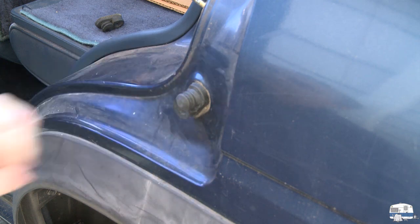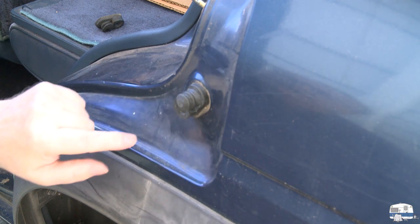I'm going to check the other side and see if that switch is dried out and breaking up as well. It's a simple but critical fix — the battery would run down if the switch didn't open and turn the lights off whenever I use the car. By the way, my car is a 1993 Nissan Pathfinder and it has fewer than 70,000 miles on it — that's original miles. I don't drive much; I get a discount on my auto insurance. I put on maybe three or four thousand miles a year and only fill the tank up once every two or three months.